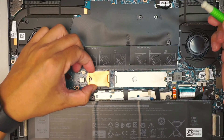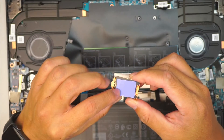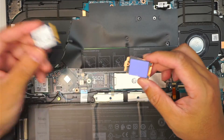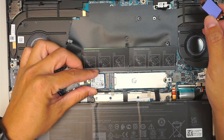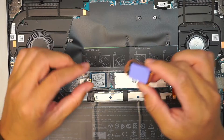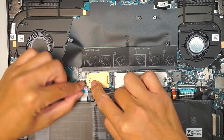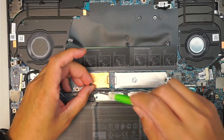Remove the screw and remove this heat sink. That is the thermal pad which allows the M.2 drive to conduct the heat away. You want to slide in this M.2 here — this is the 2230 model. What you want to do is align that little screw directly on top of the M.2 drive and put that final screw in on the top.